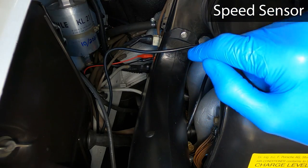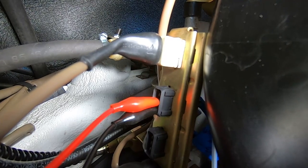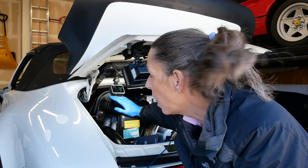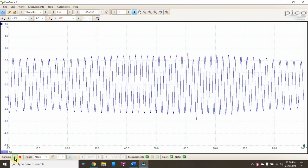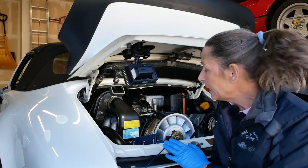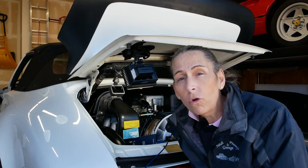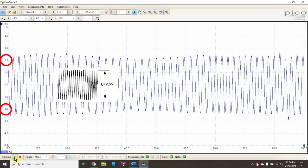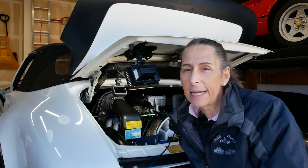Next, let's test our speed sensor — it's the middle connector of the three back there. The top one is the temperature, the middle is the speed, and the bottom is our position sensor. I've also pulled the DME relay because I just don't want the car starting — all we want to do is crank it over. We are getting a good signal from our speed sensor. It's peak to peak about two volts positive, two volts negative. The total voltage difference from peak to peak should be at least 2.5 volts, and we're past that — we're close to four. Our speed sensor is doing just great, and I'd expect that — it's a brand new speed sensor.